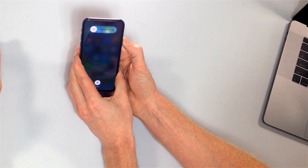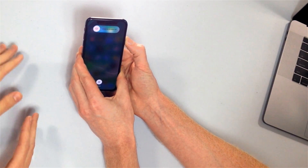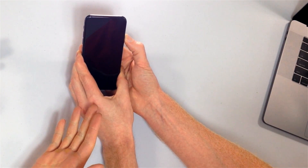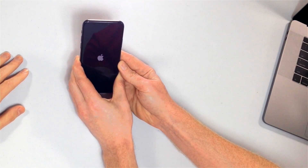Don't give up. You may need to hold for 20 to 30 seconds. That's one of the most common issues — people don't hold their side button long enough and they're like, why didn't my iPhone hard reset? You've got to keep pressing and holding until that Apple logo appears right in the center of the screen, and your iPhone will turn right back on and it has been hard reset.